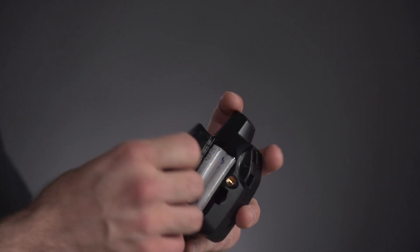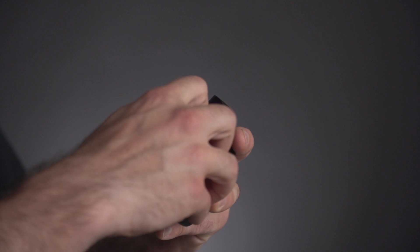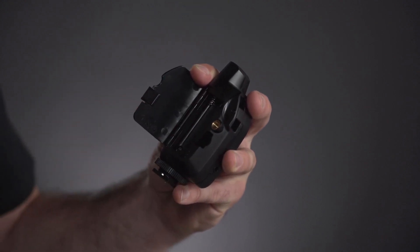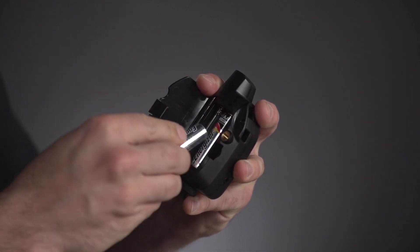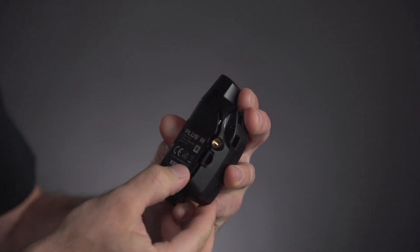The most basic thing we need to check are the batteries. Are you using fresh batteries? Sometimes batteries right out of the package or even freshly charged rechargeable batteries can be subpar. They can show full power at installation and then be low voltage just a few moments later. Try different ones. If you're using rechargeable, try alkaline or vice versa.